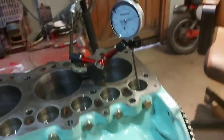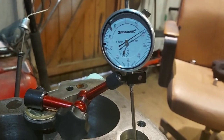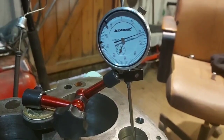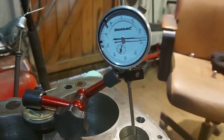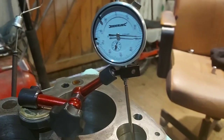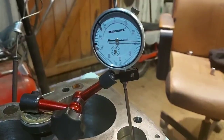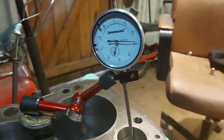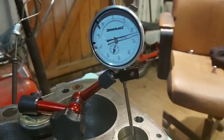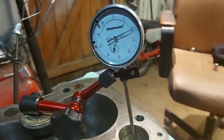And what you can do now is adjust it. As I turn it, obviously it's still going up. I'll turn it right back like that. Right, so as it gets to the absolute peak of its travel, which is there, on that peak you've got 4 degrees of travel before it starts going back again. 4 degrees is not a lot. I've literally just moved it a couple of centimetres. Right, so set it up somewhere where you know roughly where it is, look.